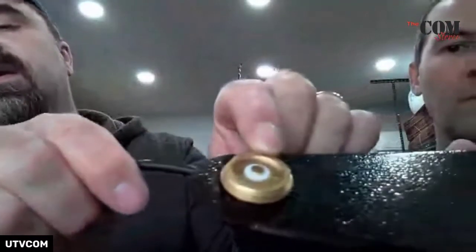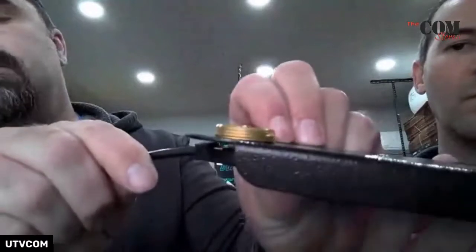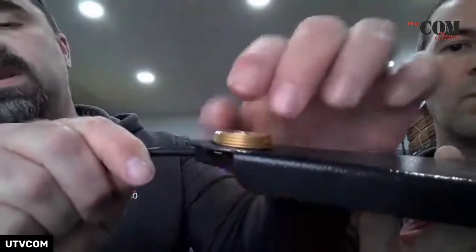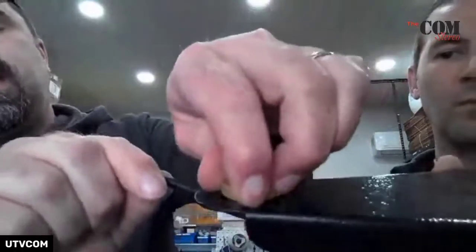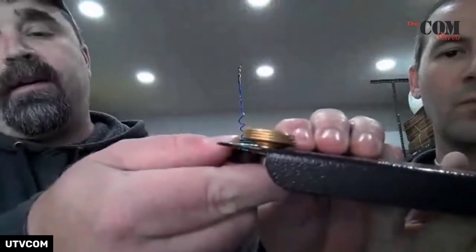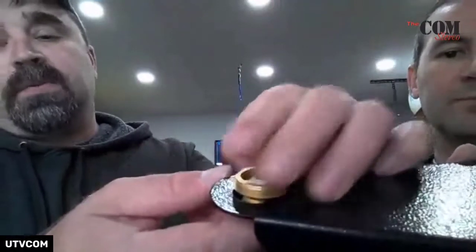You can see — if that metal is too thick — this little button on top of here, you see that little guy? That little button needs to stick up above this thing, or at least be flush with it. You don't want it to be recessed. If that metal is too thick, what ends up happening is the screw only goes down so far because the metal is that thick, and that button ends up recessed.